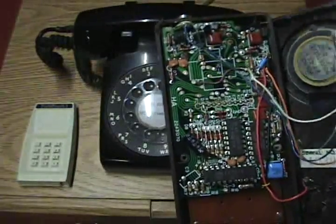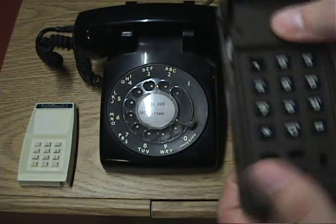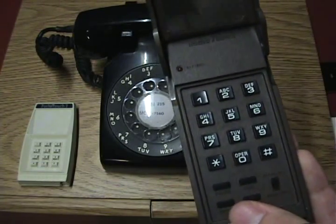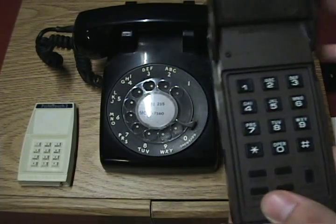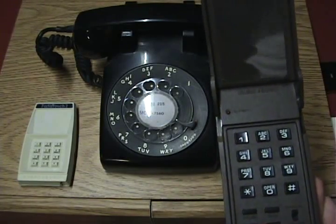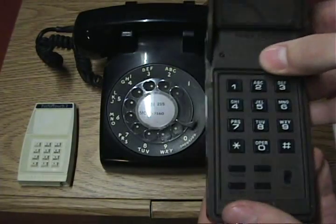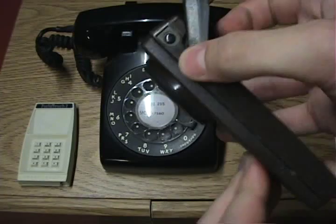Here's the board. Flipping the cover up, you have your keypad and you can dial any phone number. You can probably hear the beeping made during that. If you have this tone dialer up against the headset when dialing, that sound will actually turn the phone off for some reason, so if you're going to dial a number using this type of tone dialer, do it before you have it held up to the phone. After I have that number dialed in, I can hit the dial button here and it plays it, or hit the one on the side — it does the same number.